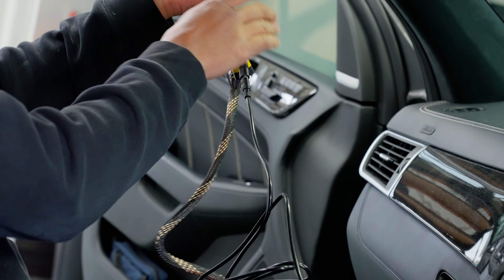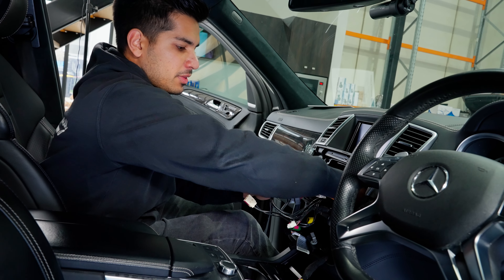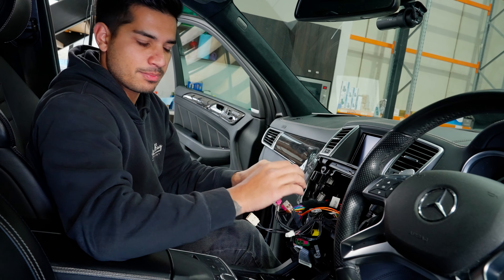The main quad lock plug and play section goes down and back. Don't keep too much tension on it — be very careful. Keep in mind that when you go back in with the factory radio, it doesn't get pinched or cut, because light runs through these fiber optic cables — so be very careful with them.